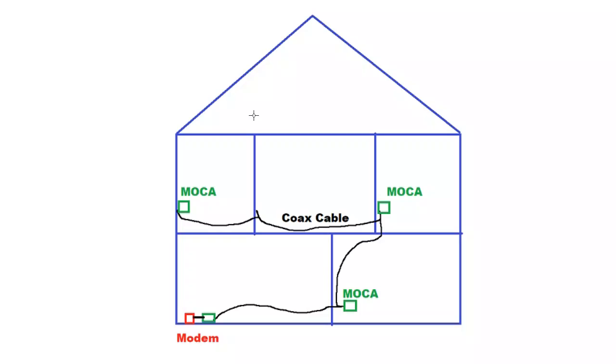If you're into 4K streaming, that's another area where Wi-Fi just might not be enough. A lot of people live in more dense areas where Wi-Fi is extremely congested, especially the 2.4 gigahertz band. My recommendation these days is to ignore the 2.4 gigahertz band — there are just too many people trying to use it. Dedicate devices that only work on 2.4 gigahertz to that band, and move everything else to 5 gigahertz. This will necessitate adding APs to your network, so for all of these cases, Wi-Fi might not be the best solution.